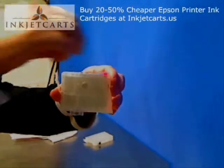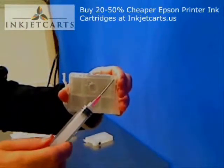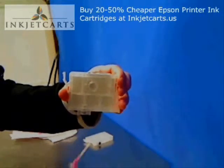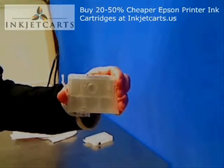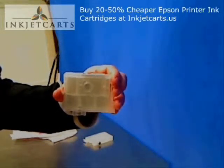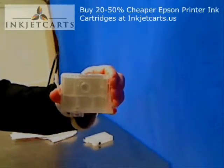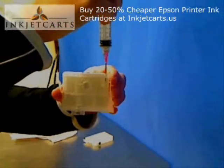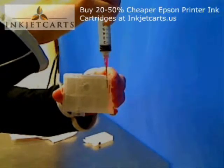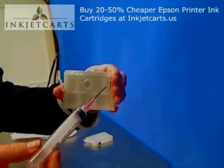If you would remove the air port — the air port supply path is slightly different. It has baffling, a silicone disc to control pressure, and it has many restrictions. There is an air pathway that leads all the way to the bottom of the cartridge and provides air separation, so your inks are never truly in direct air contact inside this cartridge. If you enter the air port, you can see clearly that the needle will not pass the first plastic inside shell. This is your first identification that you're in the wrong hole if you're trying to fill this cartridge.